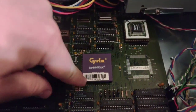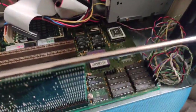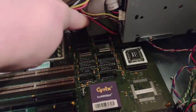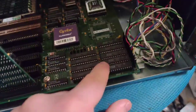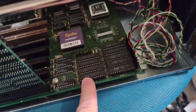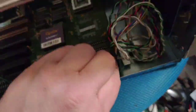going through. It has 2 EISA slots. It's got 8 megabytes of memory. I got a Cyrix CX486 DLC 40GP, as well as the 387 Mathco, 40 megahertz. And I'll also upgrade the clock oscillator to 80, which of course has half the speed. Some clock oscillators you have to have double the speed for it to be the exact speed of the processor. It's got 64K of cache on here, but unfortunately I have no idea how much it will take. It's got 2 different banks here. It's got bank 0, bank 1, and then you have the tag, I believe that's what it's called. Yeah, tag. One of the chips got loose somehow.